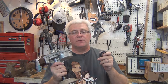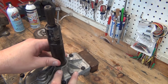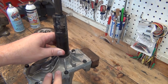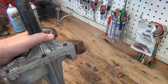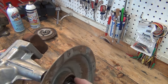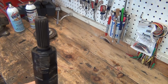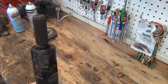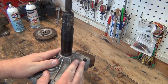So we're going to go look at how I did this. This transmission is not serviceable. If there's anything broken in this transmission, don't even bother taking it apart — you're not going to source any gears or anything in there, so you have to replace the whole unit. The transmission works when the motor spins one way and the brake assembly is engaged — this will spin, and when that spins in one direction, this transmission causes this gear to slosh back and forth, which sloshes your agitator back and forth. All the gears and everything are fine in here.